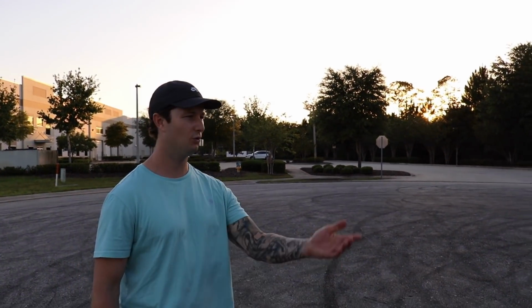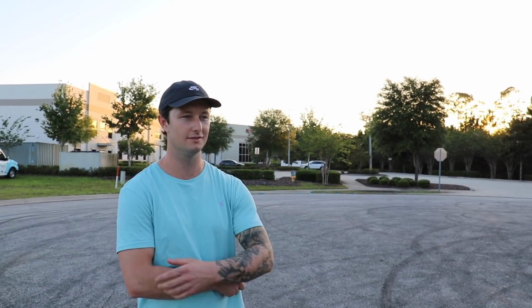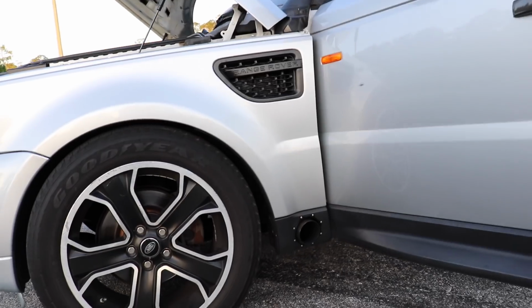So how much horsepower is this capable of? Well, this is a super common drag racing setup for the GM guys. So I'm not doing any rocket science by putting this in this chassis, and these people are making 800 to 1,000 horsepower with this setup all the time. It's on 7 pounds of boost and pretty soft timing right now, so it's a safe drive, but I'm not beating on it yet, and I don't plan to. Until it's ready to be ripped on with drag radials and a hot tune, we're just taking it easy for now. All right. You want to start it up? Yeah.